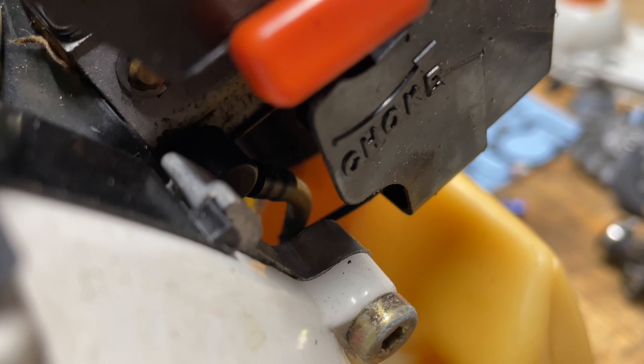I think this is just going to be for measuring purposes because as you can see we have quite a gap here. So what we want to do is put a nut on this side and a nut on this side, and then we know exactly where they need to go so we can cinch them tight. The best way to do that is to leave these bolts in here, pop this bracket off the back, and then slide the tank in and out how we want it. Make them both equal there, then we'll slide the tank back on and put the other nuts on and cinch them up.